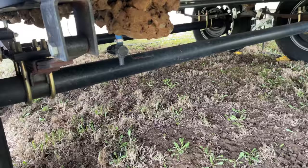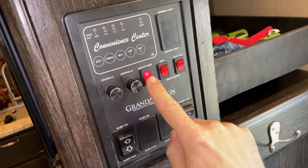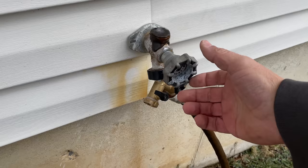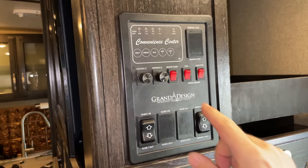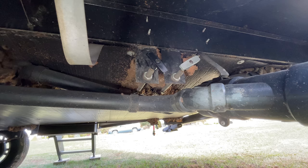It's been eight hours, so you can go ahead and open your freshwater tank drain and drain out the sanitizing solution. If children or pets frequent this area, you may want to consider where you're dumping this solution — it is a heavily diluted solution, so it's ultimately your decision, but it is worth mentioning. After the tank is empty, go ahead and turn on your water pump, open your faucets, and drain out the solution into your waste tanks. Once the solution is out of the lines, you can turn off your water pump. Don't forget to open your low point drains to get the solution out of there as well. Fill your fresh tank with fresh water, turn on your water pump, and run clean water through all of the faucets until you no longer smell bleach coming through that faucet. There's nothing wrong with repeating this step with a second tank of fresh water if you want. Just be mindful of how much water you're putting in your waste tanks — don't forget you'll have to drain your waste tanks when we're done with the de-winterization process.